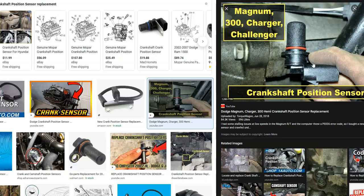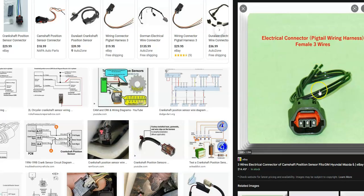Most people would just go ahead and swap out the crankshaft position sensor if they get this error code, but the wiring is pretty simple to check out — it's not very difficult to understand. In older Dodges there would be two wires, in newer ones there could be four, so always get the schematic for your particular Dodge and engine. By far the most common is three wire.